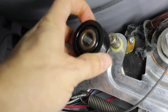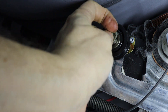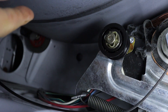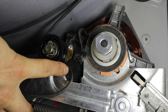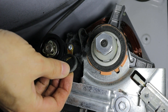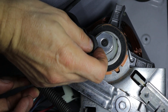Now I should be able to put everything back together. I'll bring the triangle clip back in and clip it over the center shaft so it locks into the groove at the end. Now I'm going to get the belt routed back into place. I apologize if my hands get in the way — there's not a lot of room in here to work. I'm going to wrap the belt around the tensioner pulley and leave a loop for the motor, then lift up on the idler arm and bring the belt around and loop it around the motor pulley.